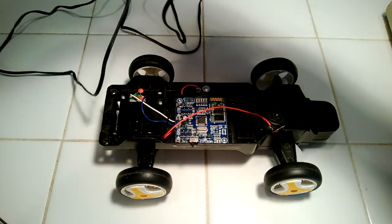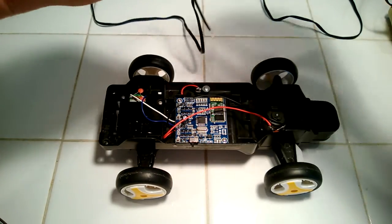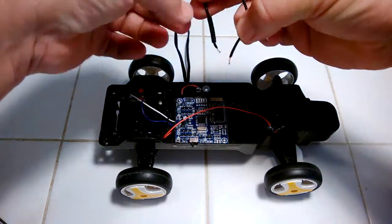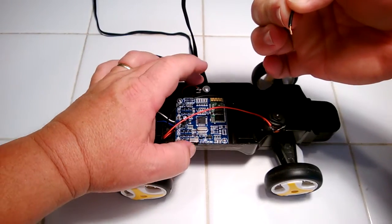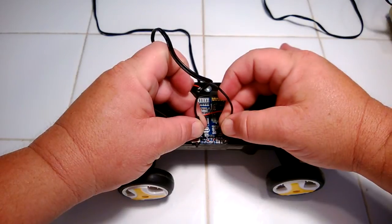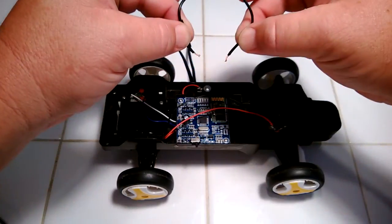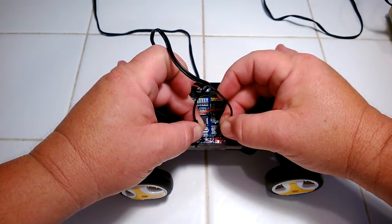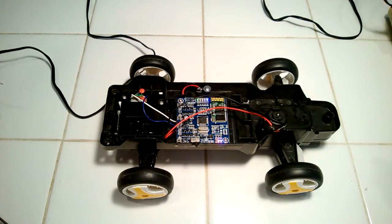So I'll take that and plug it in — I have a little power strip over here. Make sure to keep the tips apart. I'll turn the car on and then apply positive and negative for about five seconds. Take it off, try it again for another five seconds, and you can see the lights have now come on. I've jump-started this thing.